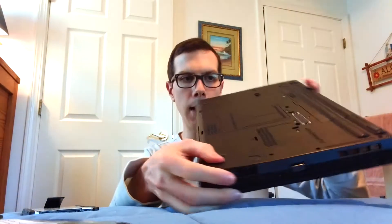I took off this part right here on the ThinkPad — it's on the left side, where your left hand would be if you had it right side up, right where the USB ports are. You pull that off — it's just one little screw, super easy, I just used this keychain knife. I popped that off and the hard drive was right in there. I just pulled this little tag out so I could pull it, and there's the hard drive.